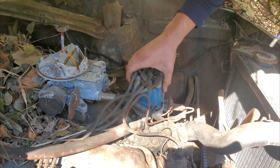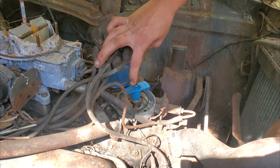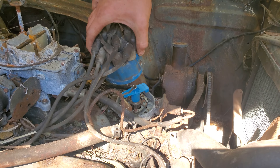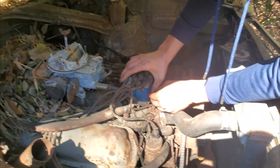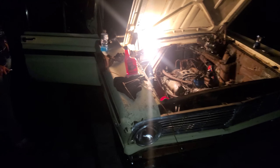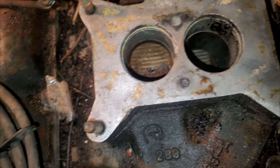When it comes to the ignition, I had a feeling this cap was brand new or recently replaced, and I still think so. You can see it has a Motorcraft rotor right there, with what looks like older points and condenser. So hopefully this thing gives off good spark — I can always test and clean that, whatever I need to do. Right now I'm just taking the carburetor off, and if you see in there, it's pretty clean. There's some gunk, but it's all right.